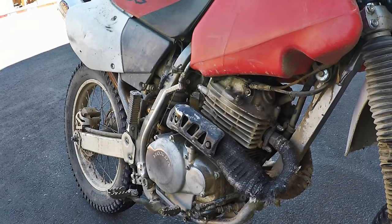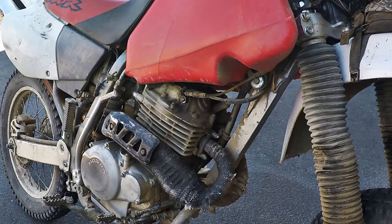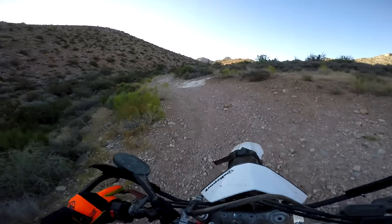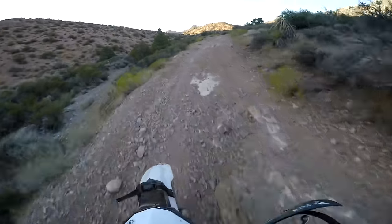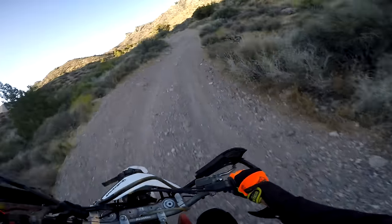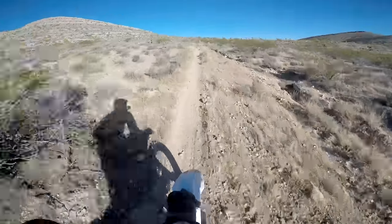Engine, transmission, and fuel efficiency. The engine is a four-stroke, air-cooled, 249cc, over-square, single-overhead cam, radial four-valve single with a dry sump oil system and a 30mm carburetor mated to a six-speed transmission. What all this translates to is basically one of the most unique engines ever found in a dirt bike. The combination of an over-square short-stroke ratio, four radially-aligned valves feeding a hemispherical combustion chamber, and the light rotating mass of a single-overhead cam all come together to make a quick-revving and free-revving engine with plenty of potential.